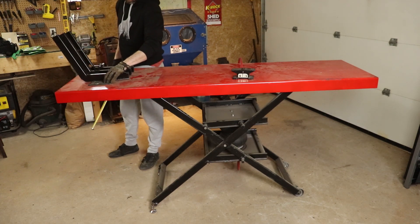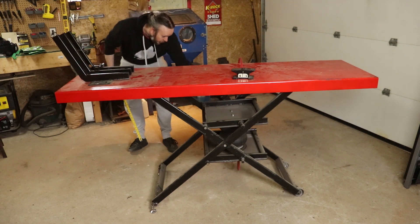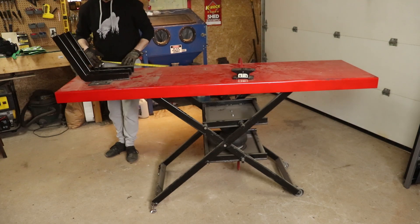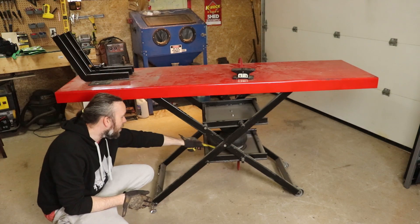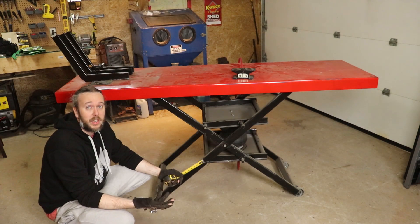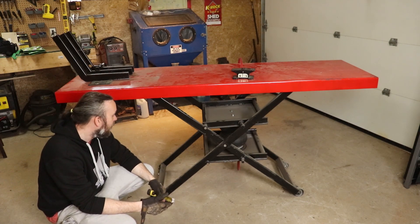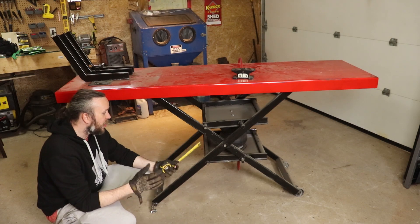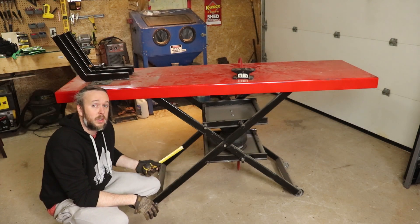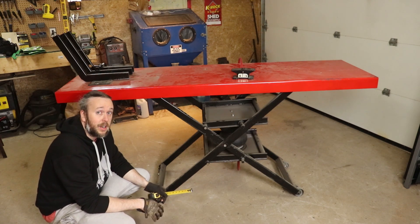This piece of plate here is made of the same plate that the lifting mechanism is made of — just make that to fit. Regarding the bag, any bag will do as long as it'll handle around 90 to 100 PSI. It'll give you the lift and weight support you need. I'll link the one I use, but you can use any other bag. I'm considering upgrading to something a bit bigger so I can lift heavier bikes, but I've been able to lift everything I've wanted to so far.